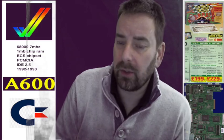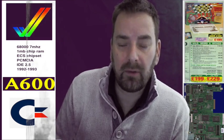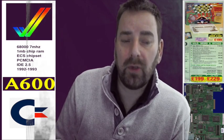This does not support the built-in IDE, nor does it support the PCMCIA. So you will have to change the Kickstart ROM if you have one of these machines. The drivers themselves for the IDE and the PCMCIA were loaded from a floppy disk drive. So the IDE will not auto boot. Later versions 37.300 and 37.350 address this problem, and the drivers were built into ROM.